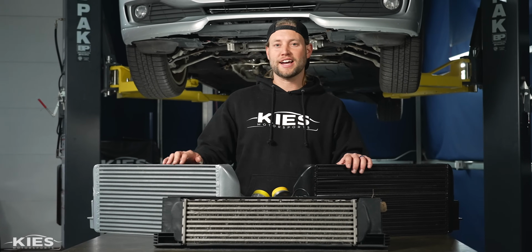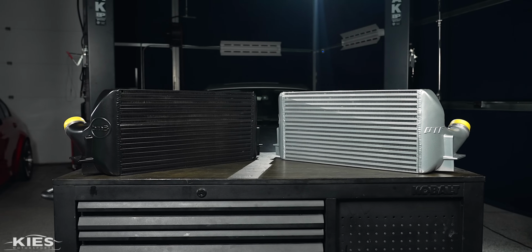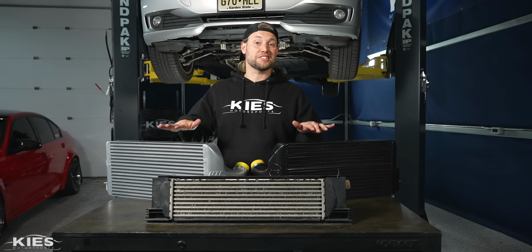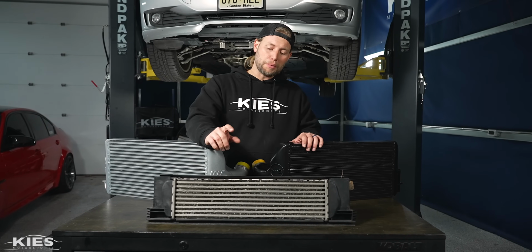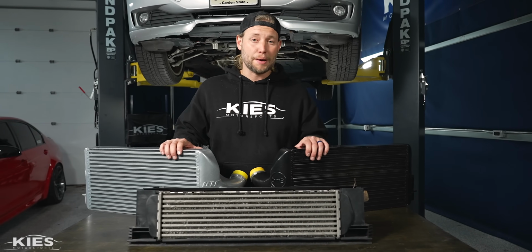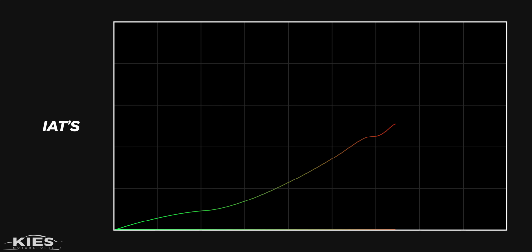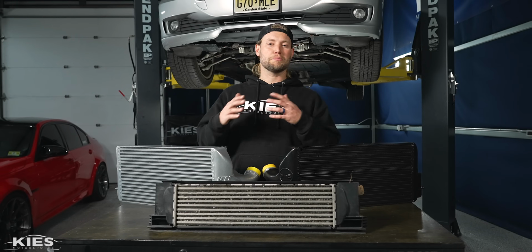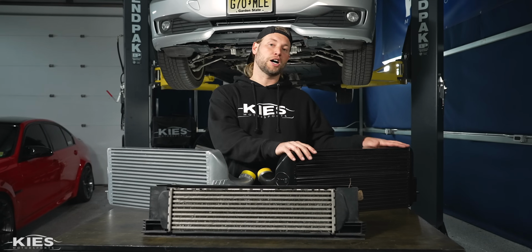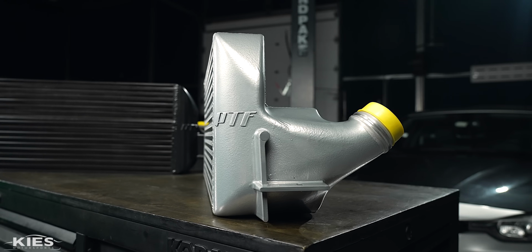In today's video, we're going to show you how to replace your wimpy stock intercooler with ProTuningFreaks all-new race intercooler. Now, before we jump into the DIY install, I just want to tell you a little bit about what makes this so cool. First off, the problem with the stock intercooler is that, especially once you start to turn up the boost, it can't keep up, and your IATs, your intake air temperatures, can start to soar. The more heat your car detects, the more it's going to mess with your timing and reduce your power. So what you can do is add an upgraded intercooler like the one from ProTuningFreaks we have here, which is going to improve your IATs and your power levels.